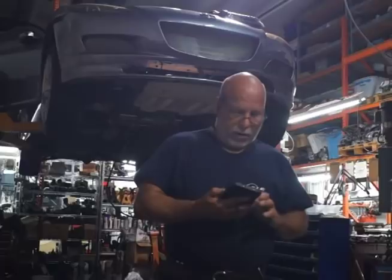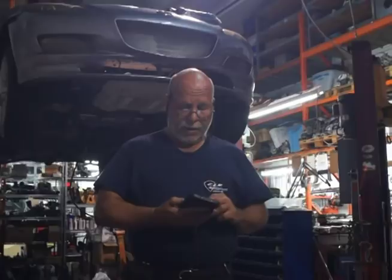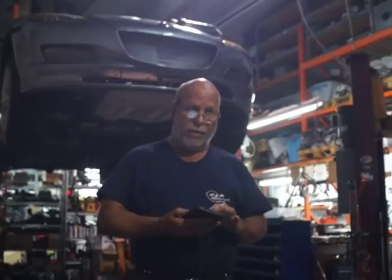Yeah, but I was reading, just trying to find some information, and people that live in the north, that put the cars away for the winter, that run flex fuels, they're talking about emptying them out, because for Ford it becomes a major issue? Yeah, Ford recommends on their F-150s to empty it out and run 20 gallons of gasoline for a minimum of 20 minutes before they park it for a long period of time.